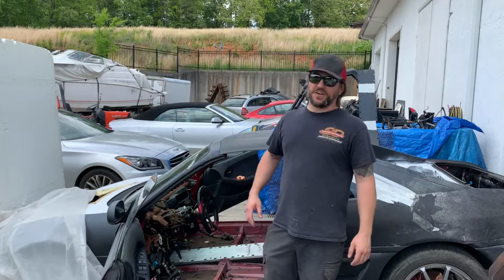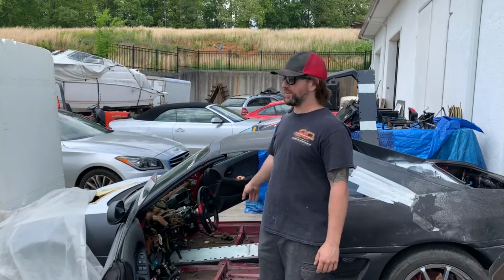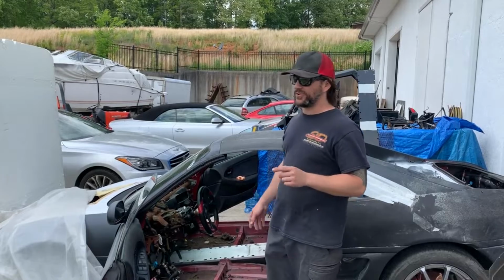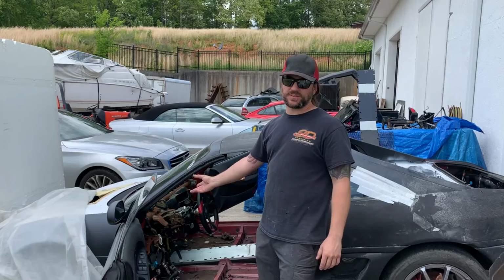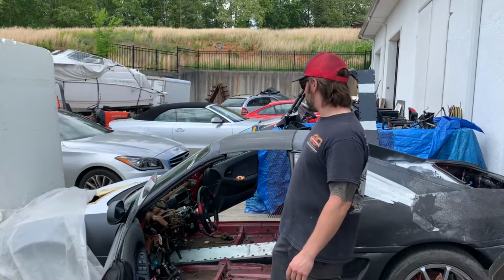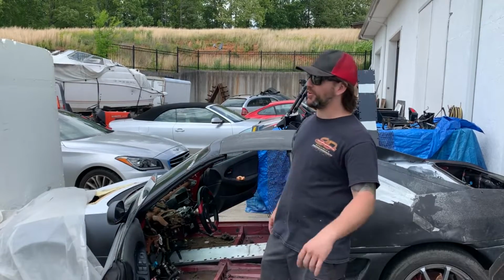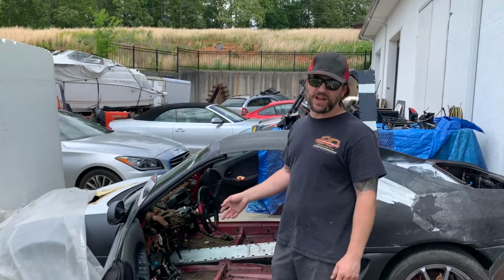Tunnel out of this car, and they have a plate for the Fisker Karma batteries. It's kind of sat in here. Now I gotta figure out how I want to make them bolt in. I want to utilize their whole setup pretty much besides the back part, but I can get most of the batteries right in here without cutting any of the structure out of the car, minus that tunnel, but any of the main structure. So I'm going to take some measurements now and then we'll see.